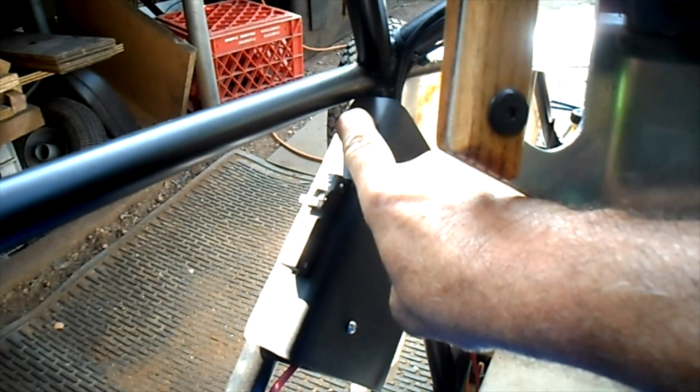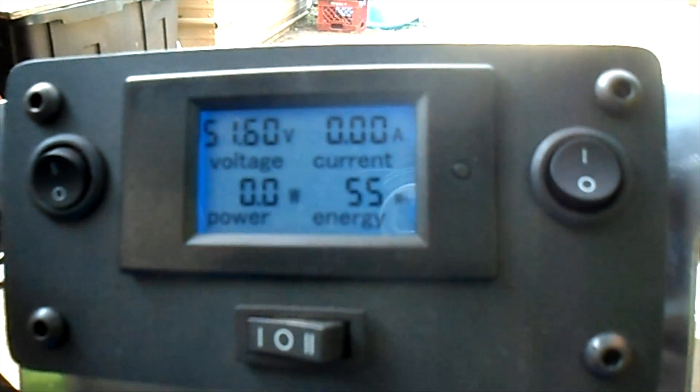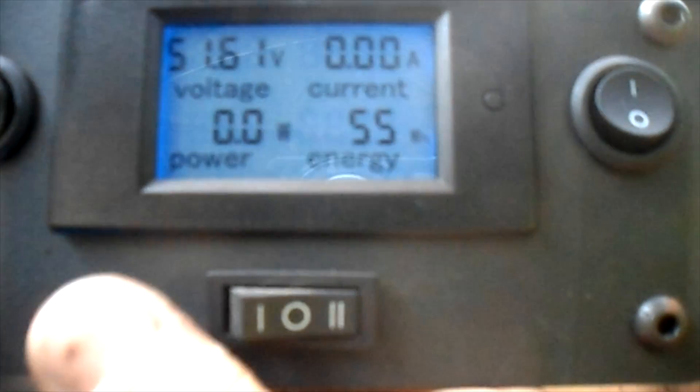Just like with the 60-volt system, I hit our pre-charge button, wait five seconds, and turn the system on — everything is still off. Then we turn our power switch on, which turns on our meter and the speed controller in the back, so the system is ready to go. The meter shows 51.6 volts in the battery pack. This is our forward/reverse switch — when it's off we're in forward mode, and when we switch it up it's in reverse. And this is our three-speed switch: low, medium, and high.